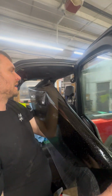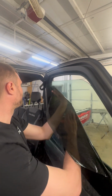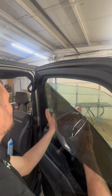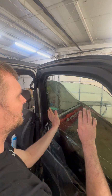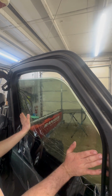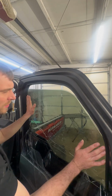And once in, we're simply gonna set this back side of the door in first, leaving this front edge away. And once we got this landed on the glass, we're gonna slip it behind that gasket and we're gonna just kind of use our hand to get it to where it needs to go. These are pretty deep gaskets on this machine, but it does help you.